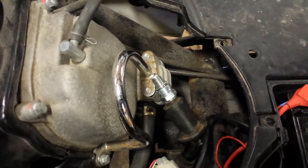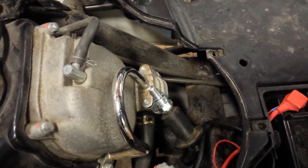You can see it's got no spark whatsoever. I do have fuel, so I know fuel is not the issue. Since there's no spark, the first thing I'm going to do is check for any inline fuses — I have checked those and there's nothing that seems to be the matter there.